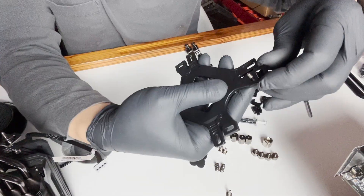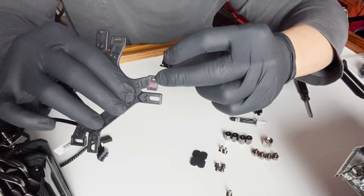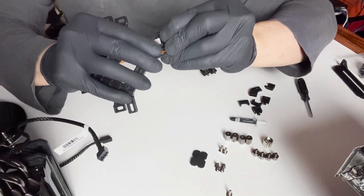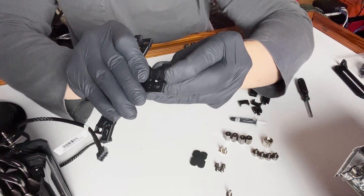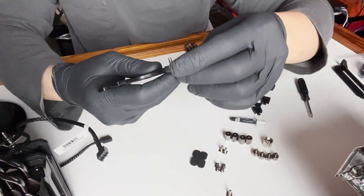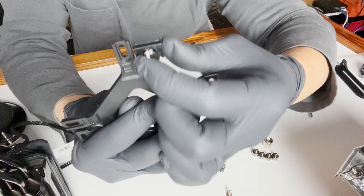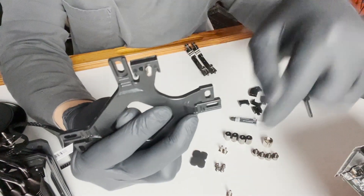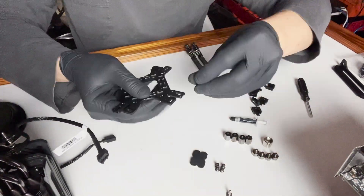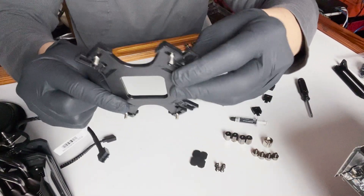The flat part sits on the bottom with the flat side of the T. Slide it in until it clicks — once it clicks, you can shift it left and right to get it into position on your motherboard. We'll do that for all four corners. We can shift them to make sure they fit properly on the motherboard.